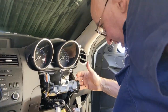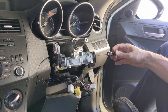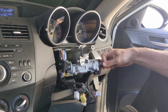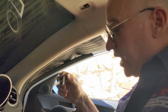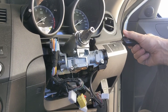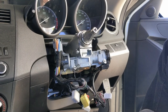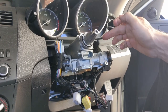So as you can see here, we've got the key barrel, the key barrel housing, and the ignition switch. At the moment the car does start okay, but what we're going to assume is that we don't have a key. In my last video I showed you how you can actually remove the barrel out of the barrel housing, but to do that you needed to put the key in the accessory position. In this video we don't have a key, so I'm going to throw this in the back — we're never going to go back to it — which means I've got no way of getting that barrel out of the barrel housing.